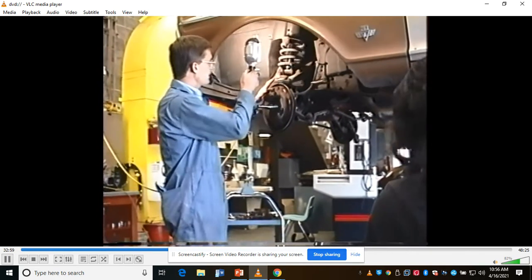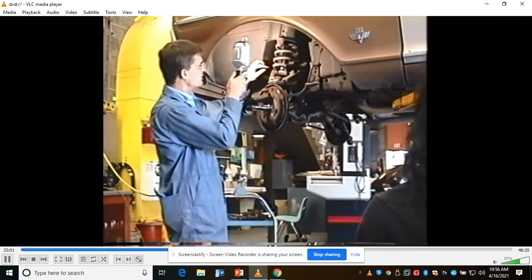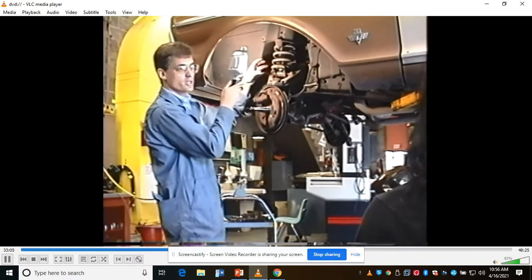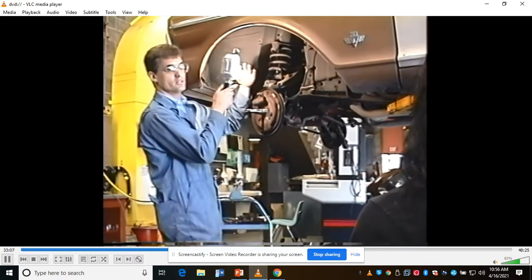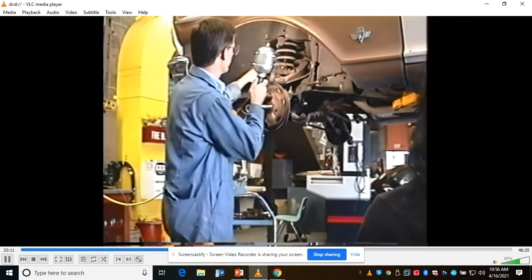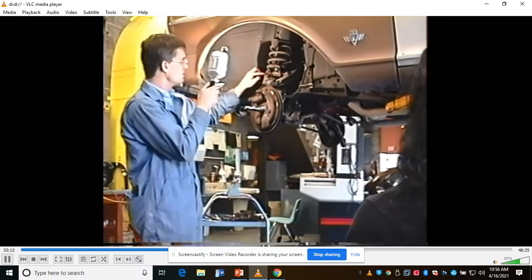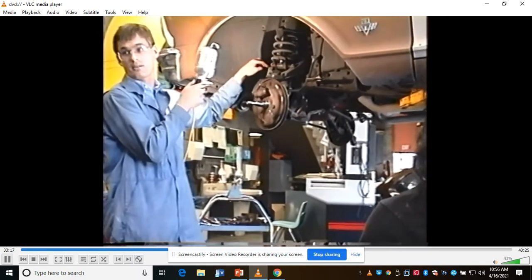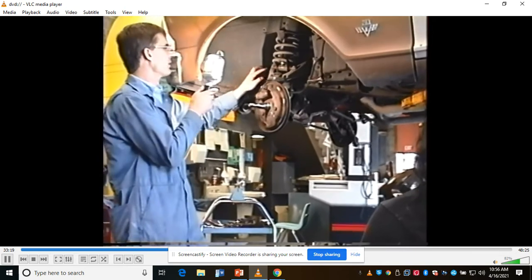One thing you're going to notice, and I don't know if you guys can see it from where you are, is this perch, which we call a spring perch for the spring rest. It's got a bushing in there because it has to pivot slightly as the control arm goes up and down. Where the bolts are, there's some rust color. These bolts have broken my control arm right here. Look at the underside. It's all cracked. When I take it apart, I'll show it to you.